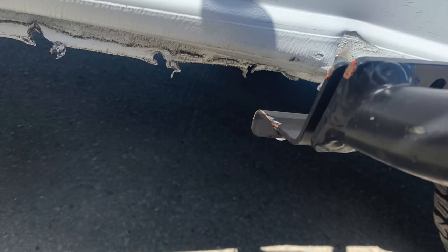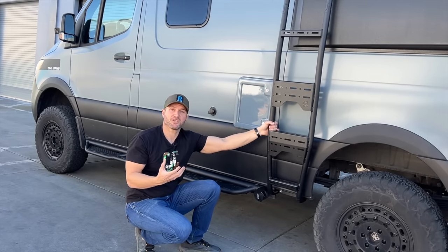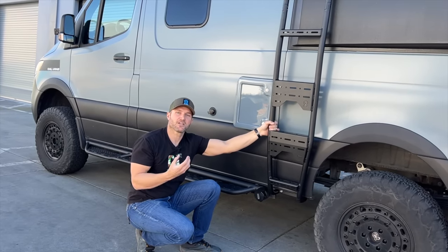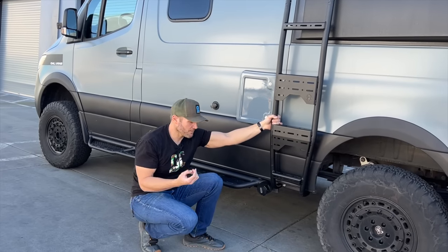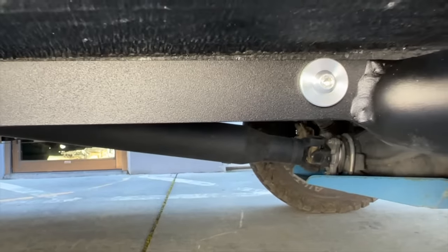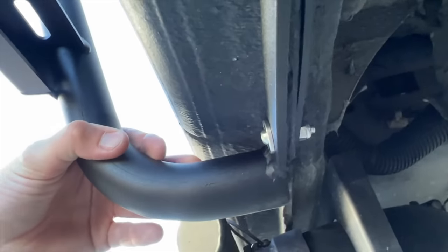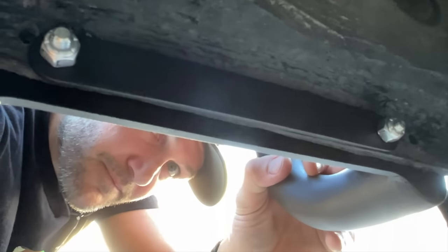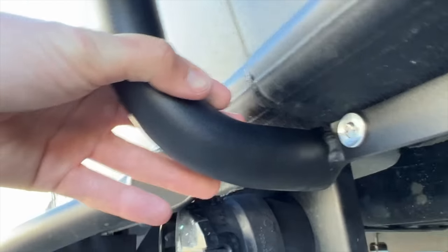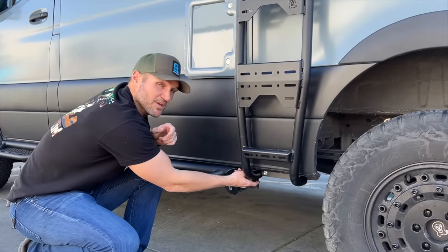Well, that's not carrying any load. The load is on the top bolts. The ladder's resting against the pinch weld. You don't need to make that mount strong. So what did we do? We actually purposely engineered that mounting point to be incredibly weak. These are aluminum bolts. The shear strength is incredibly low. What's important about that is even though this is high and tight, should this ever get hooked on something, those bolts break before the pinch weld does.